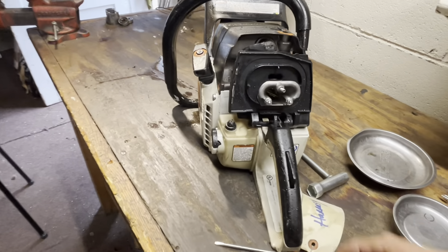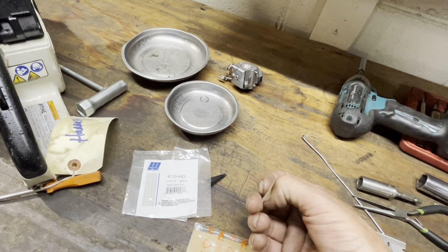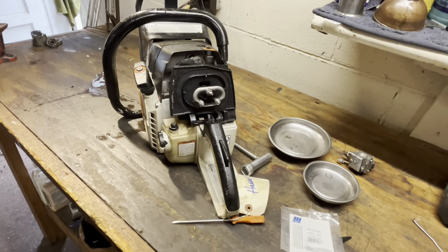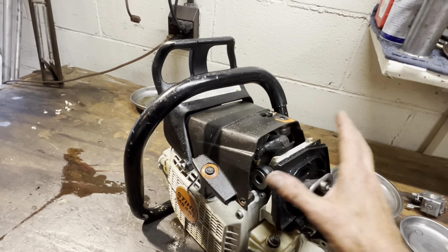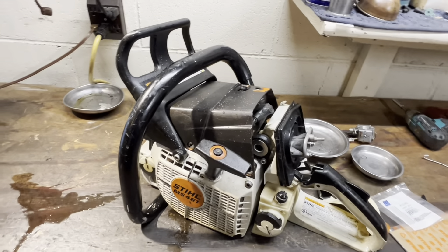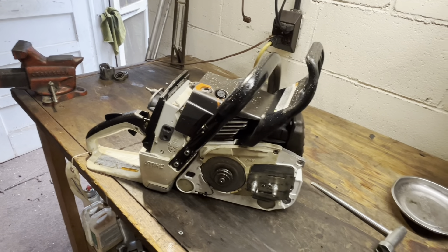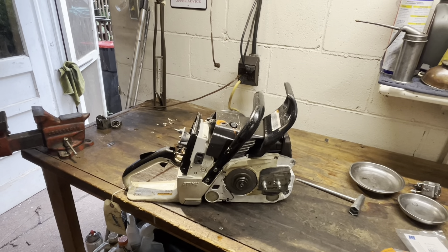I had to grab a spare carburetor I had for an upcoming build of my own. The spare carb — I put a brand new kit in it because it's been sitting for quite some time and was all dehydrated. It came back: it idles just fine, revs, runs. So we put this one behind us for the day. I've got to get an air filter — I don't have a spare on hand so I'll have to run and get that. I've also got to throw a chain catcher and a front dog on here that were missing. But that's a pretty successful build. Thanks for sticking around with me to the end.